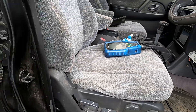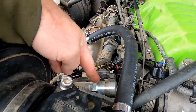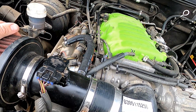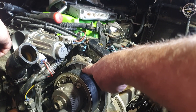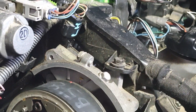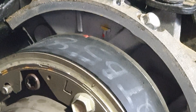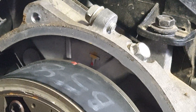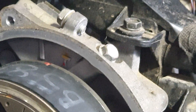That one's not new but that one is new — so something's up with that. What we find is there's the mark on the pulley and there's the mark it's meant to line up with. Let's zoom in a little bit. It looks like they tried to time it off the T — there's a red dot and a red dot. Wherever they tried to time it, they didn't get it right on the T either, because it's halfway in between. They really didn't get it right either way.